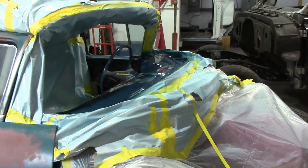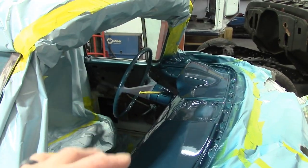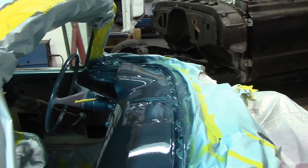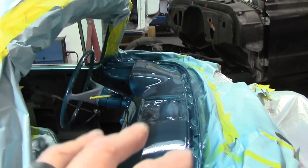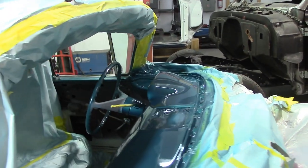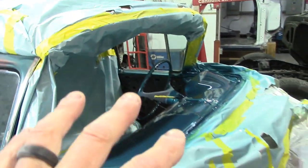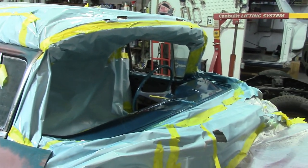There's that old rotten fuel line - someone's already joined it with hose and it shouldn't be, so I want to rip that out. Got to make sure she's mechanically safe. I painted the dash because we're rewiring the car and putting some new gauges in - nice ones that look factory but aren't. The windshield needed replacing too, the rubber was leaking everywhere, so it was time to do the dash while the windshield and gauges were out.